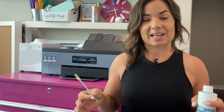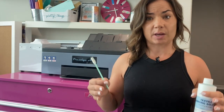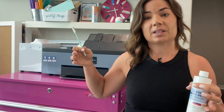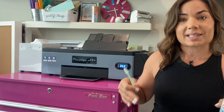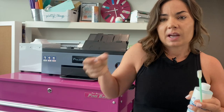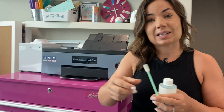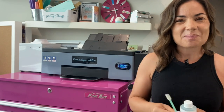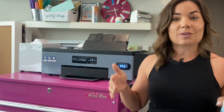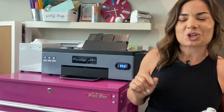That's it — just those three things that you are going to definitely want to check on a daily basis after you print. If you end up having printing problems where a color is not printing correctly or colors are not coming out of the print head as you would expect, then you will want to take a few additional steps to do nozzle checks and a print head cleaning. But otherwise, on the daily, after printing, just those three things: clean that area where ink can collect, clean the wiper, and check the waste tank. If you're looking for more videos on how to use the Prestige DTF printer, I've got a lot, so check them out. And if you're looking for the best bundles, supplies, or free film for your DTF printer, I've got that as well.